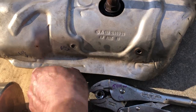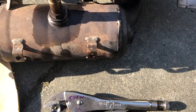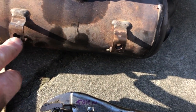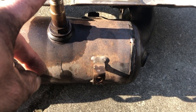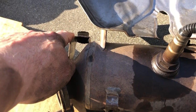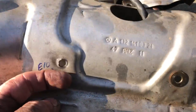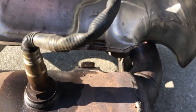There are several of them — that's the smallest size. You take this shield back, and you can see the locating female threads there. And this is the O2 sensor. But this is also a little pinch right here — it's a kind of a pinch type of fastener right there. It doesn't really have a connection per se. You just have to wiggle it off and put a little bit of WD-40 in there and wiggle it off.